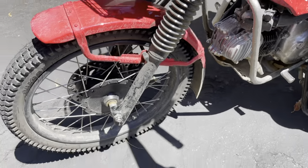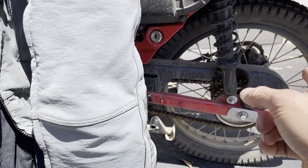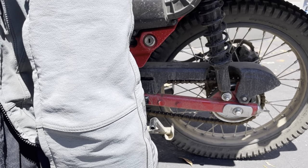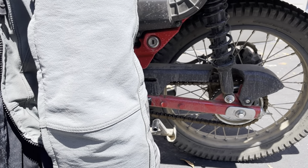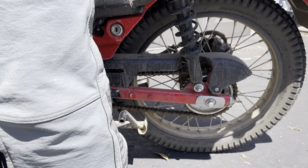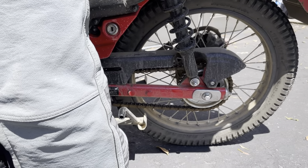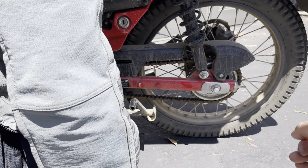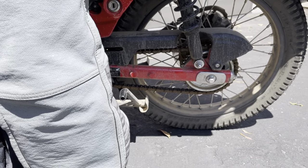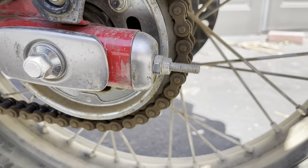So right now I'm running 2.5 in the front and 2.75 in the rear. As far as how it runs with the diameter, the 2.75 surprisingly works okay. On pavement it felt fine — it didn't feel sluggish like when I had the 3-inch in the back. In the dirt it feels a little bit tall on the gearing, so it could either use a smaller tire — say a 2.5 — or maybe gear the rear sprocket up one tooth or so, and it'd probably be okay. I think the stock sprocket is a 39 teeth.